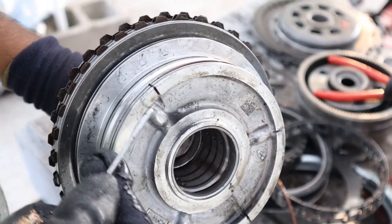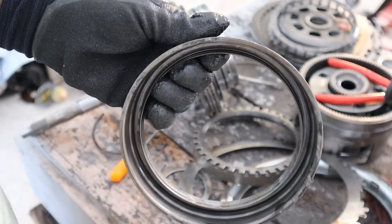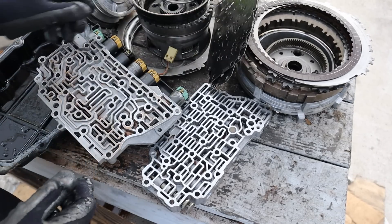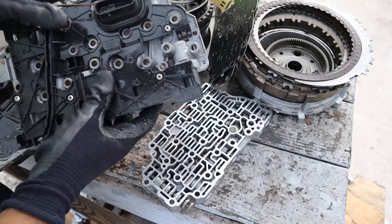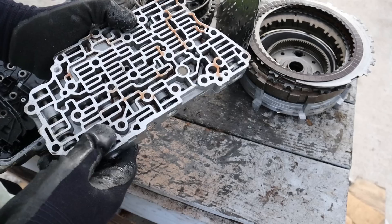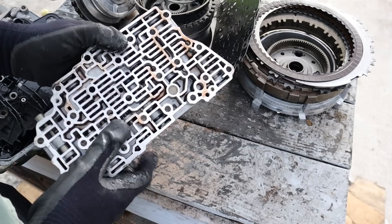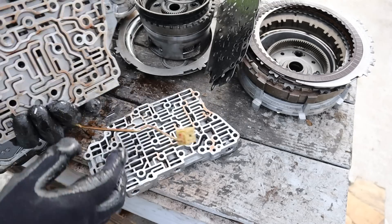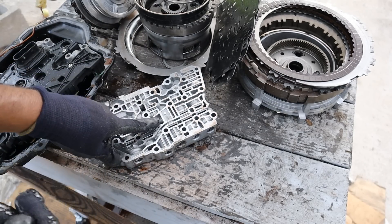You can see the holes over here which line up with these ribs, going to fill up that cylinder. These piston return springs are nice and firm. And this is what the inside of that cylinder looks like — you've got to make sure all of these seals are intact. Let's take a look inside of this valve body. Got a lot of these shims over here, and you can see that there's these solenoids located here. There is some of that paste inside of here, indicating well-use of this transmission. We do have the hookups for the computer which are going to control these solenoids, with this plastic thing being a bus bar. The valve body in this transmission is basically like a brain — they form hydraulic circuits with all of these little valves inside of here that move back and forth according to fluid pressure. These little steel balls being so hard can sometimes wear through the aluminum over here and cause something to not seal.